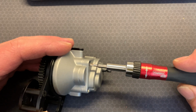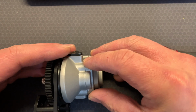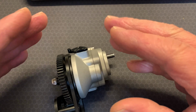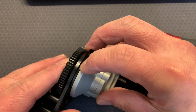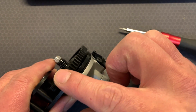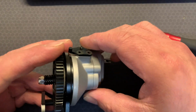But once you tighten this up a little bit more to make it sandwich tight, it sandwiches the gears together too much, putting an immense amount of pressure on them, and it holds them together so tight that it causes binding issues. This will feel very rough. When you're trying to move it, it will move like this because it's not smooth and it's bound together.